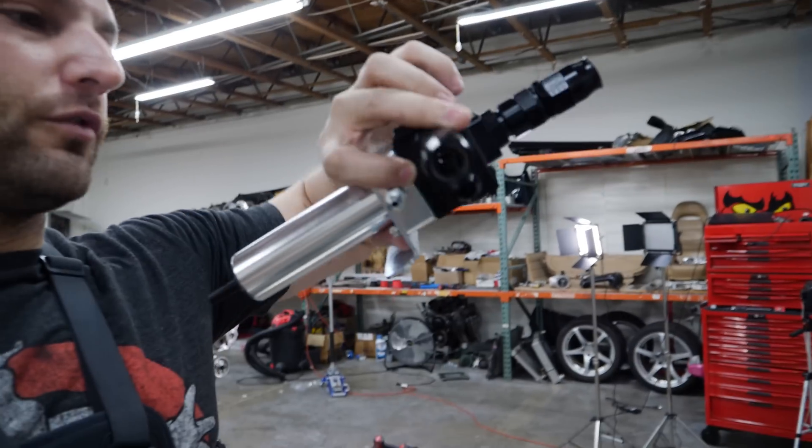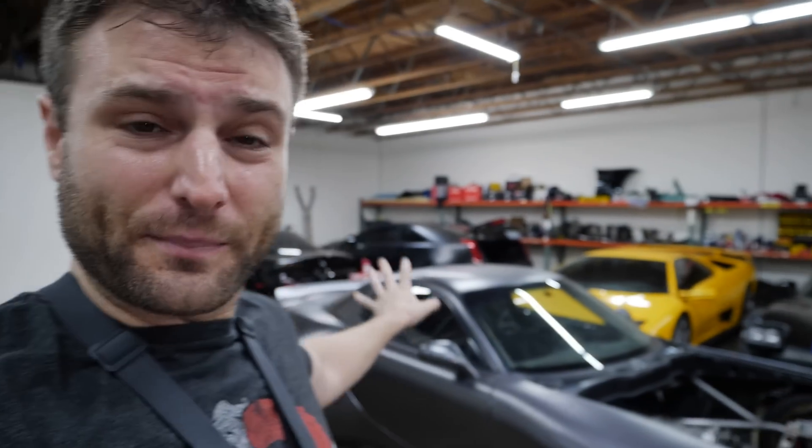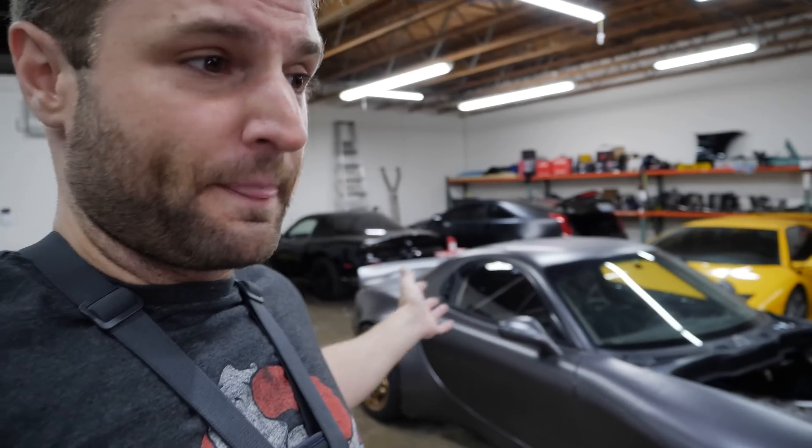That's why this high-flow fuel pressure regulator matters so much. Because I am going to be kicking fuel in and out, especially at idle. One of the pieces of magic is that I'm going to have to have the ECU control when the stages go on and off. Because that is not something you normally do with a car — you just turn the fuel system on and that's it. Now we're going to have to deal with phases. That changes the amount of fuel, flow, pressure, and so on. But we can run E85 and make as much power as we want. That is just insane. When the massive four-pump setup I had on the three-rotor was only just shy of two gallons per minute.